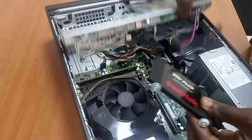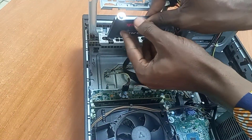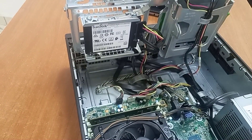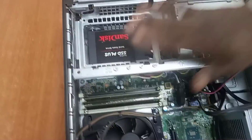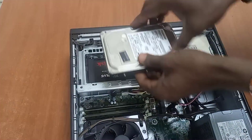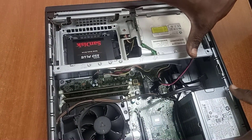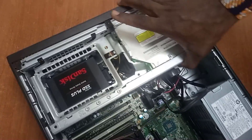We've used the side screws — one, two, three, four. Open it, check it, and connect it. You have the screw there, the screw here, the screw under — just connect it as I've connected it and close it so it's firm. If you still need the hard disk, you can see you have screw, screw, and connect — so you have both the hard disk and the SSD on the same desktop.